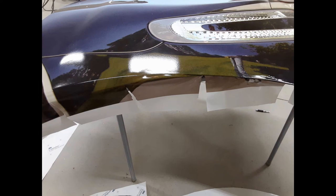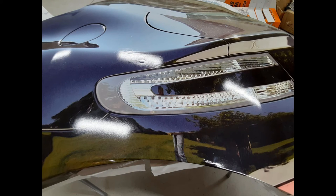It's easier when you have two people, but I had to do it by myself. Once you peel off and lay it down, you smooth it out. In the curved portions of your hood, you have to make sure you cut it every couple inches so that you can fold that vinyl and it will not crease or ripple up. And you can see how it's finished on top.